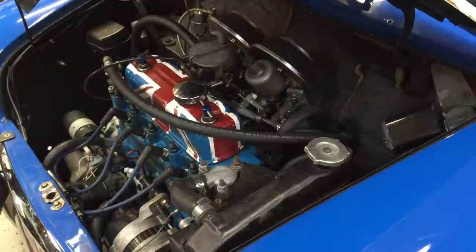Now that you've got your oil filter on, the next step is to get motor oil back in the car. If you haven't already, make sure you've put that drain plug back in because we don't want to waste all this new oil we just purchased. The drain plug has a small copper washer around it which is very important — that needs to go back on with the drain plug to help prevent leaks in the future.